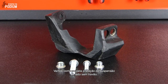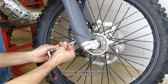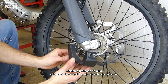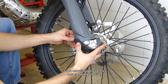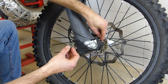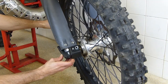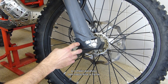Let's start with the non-brake side bottom fork guard. Remove the bolt on the back securing the fork guard and the inner bolt securing the front wheel axle. Install the bottom fork guard and install the two bushings, one in the front and another on the back. Each bushing only fits correctly in one place, so do it trial and error if needed. Now screw the second smallest bolt on the back and screw the big bolt with a full thread in front.